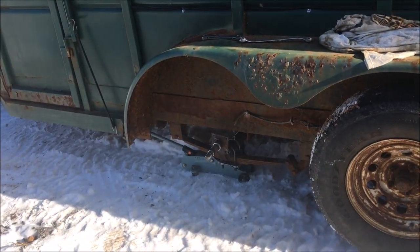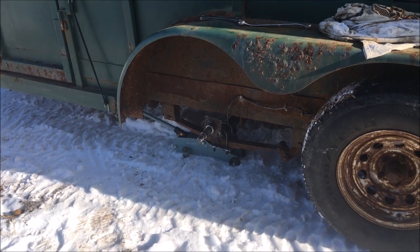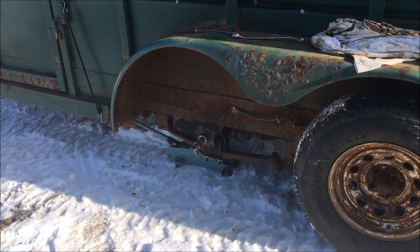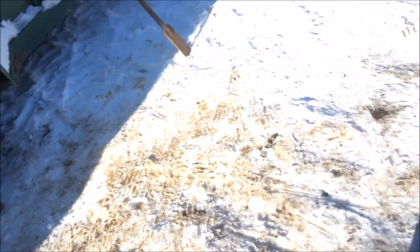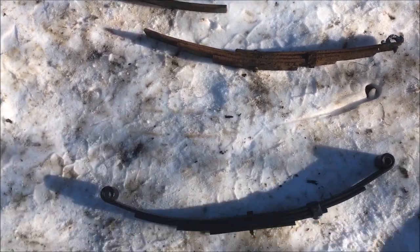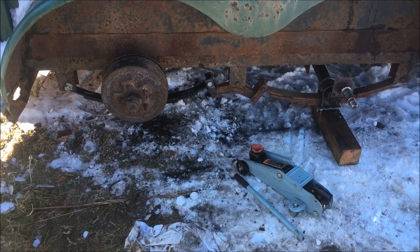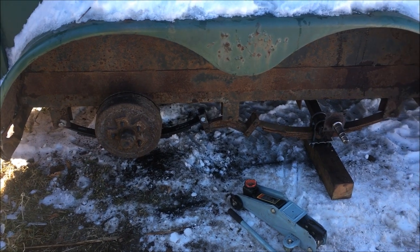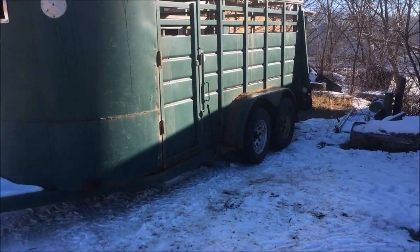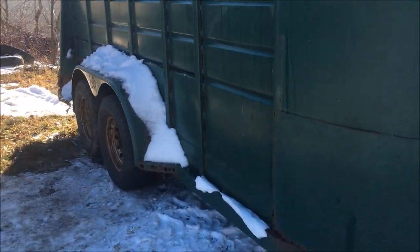The axle is bolted in and it fits perfectly. Look at this — I've got a spindle sticking out the left side of the trailer now that I didn't have when I first bought it. We've got the broken spring out — the main leaf is broke right there in the middle. Now we've got the new one, so we can go ahead and put it in. I've got the spring bolted in and the axle clamped onto it, so now it's time to put the other hub on and get this thing sitting down on its own haunches again.